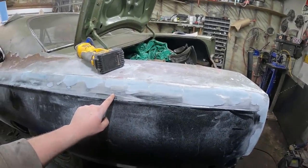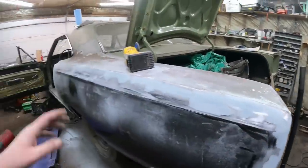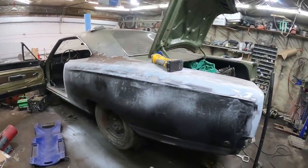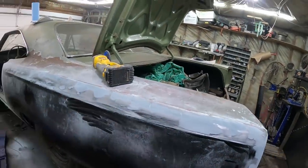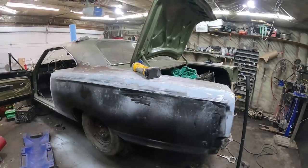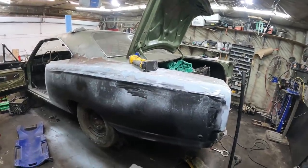So we'll get going on that sail panel and then I can shmuck that with filler and then the whole panel. I'm just going to fill here to here type thing. Make sure I keep this nice sharp body line and this nice little curve to it. So maybe I'll just put it down to there — front, back, sill. And I'm not going to worry about the panel at all, just scuff it up when I'm ready to paint with some scotch brite or something like that.